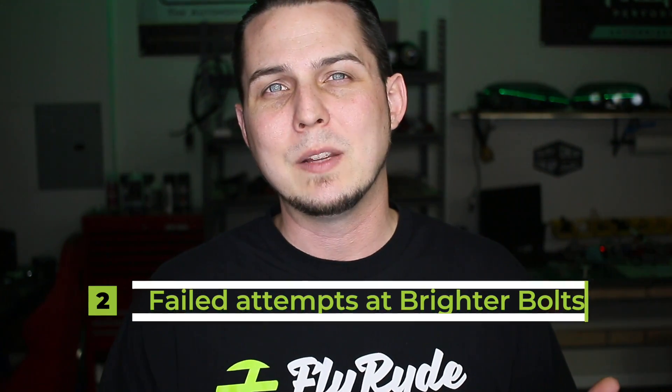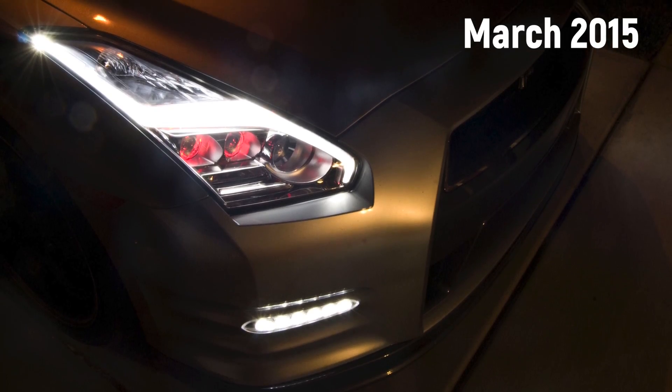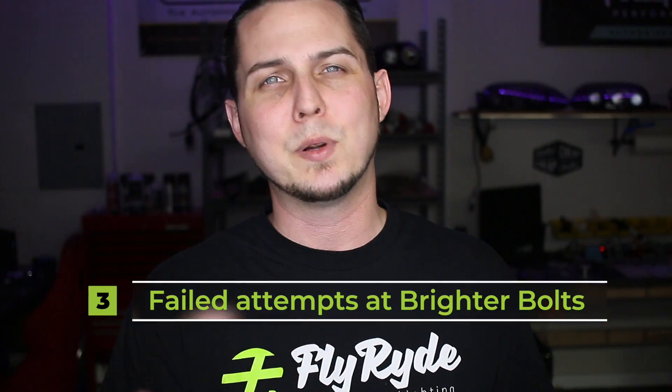I reached out to another company and they made me some really bright aftermarket lights for those two little spots. But what ended up happening was they'd get too hot and fail. I tried a different approach — I finally found an LED strip I could run all the way through there. It was a universal part, a little bit too short, so I'd add another little section of LED. I did a couple of cars that way, then they discontinued that part and put out a different version, so I had to continually adjust as time went on because there was nothing vehicle-specific made for it.